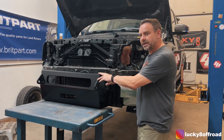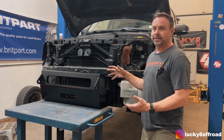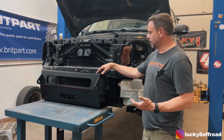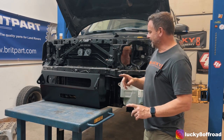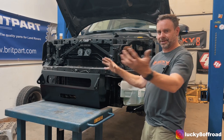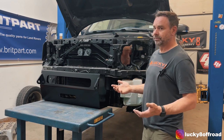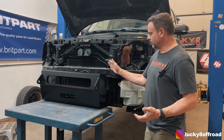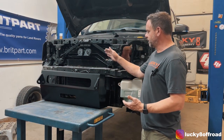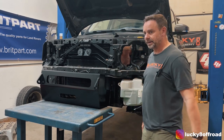Next up, we need to put the center section on. But first, you need to bolt your winch into the center section — if you're not running a winch, you're good to go. You also need to cut this portion of the front radiator support — right here and on the other side. Do not hit the radiators, it'll ruin your day. Get that cut out of the way and the winch installed. If you're doing a Proud Rhino bumper, you need to do the same thing — get the winch in and cut this, except you're dealing with a much larger bumper.